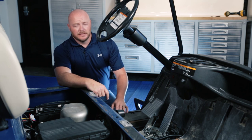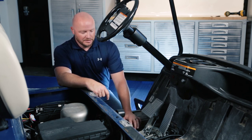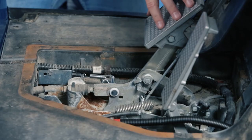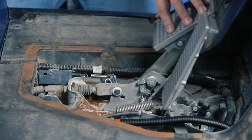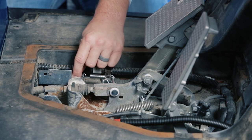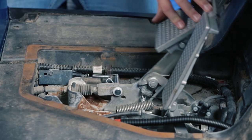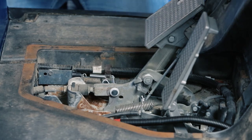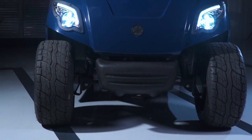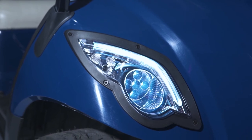Now that we have power to our harness, you're going to move back into the brake panel. We're going to check our brake lights to make sure that the plunger is working at the proper tension. If you press the brake in, you should see that the brake lights come on. You may have to either loosen or tighten the tension on the brake switch to get the plunger working properly. We're good here, so we're going to go ahead and reattach our brake cover and install our floor mat. You're now finished installing your Mad Jack's Ultimate Plus Light Kit, designed for the Yamaha Drive.